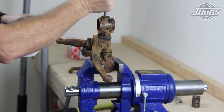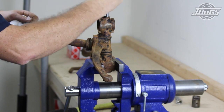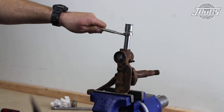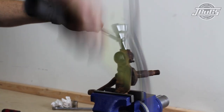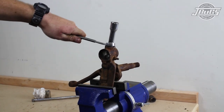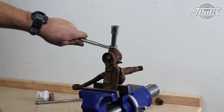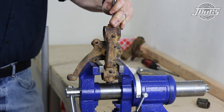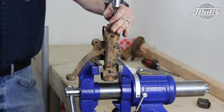Then the spindle is clamped upside down in the vise so the king pin can be driven out the top. A 6 inch extension, a closed end wrench to act as a guide, and a hammer are used to deliver numerous powerful strikes to the king pin. Note our extension has already started to mushroom out as a reminder of how much force will be needed. Eventually the pin is driven through, and with the pin almost out, a 12 inch extension is used to drive the pin out completely.